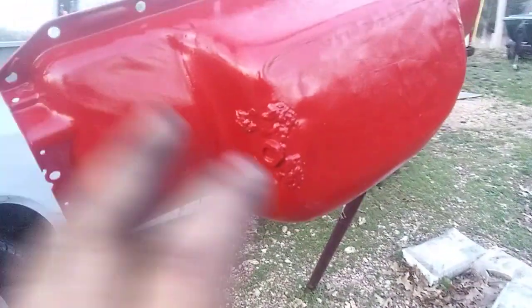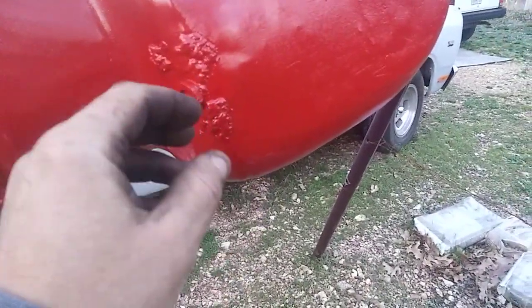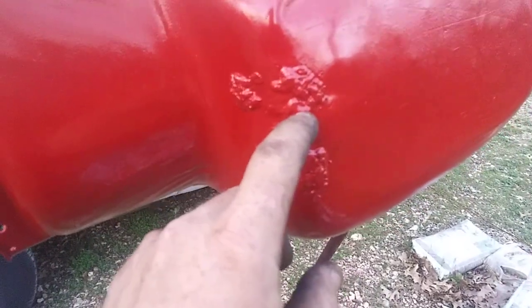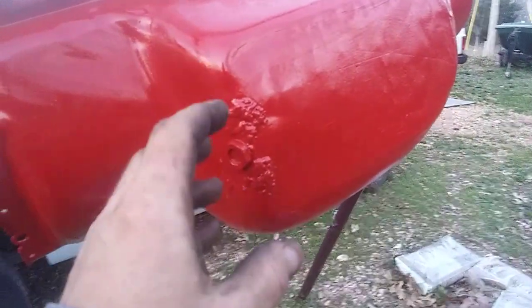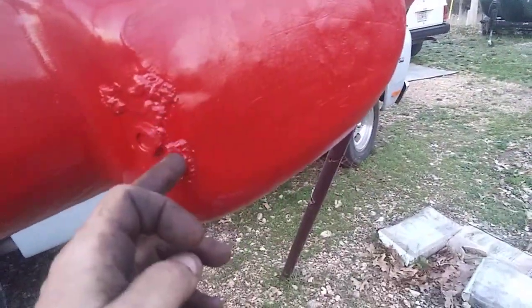I took it over to the sandblasting cabinet, flipped it upside down and sandblasted all around the big areas. Then I gave it several thick coats over that whole entire area. Prior to that, I retested it and it didn't have any leaks — it wasn't sweating any water. It looks like a bunch of bird crap or snot welds, but at least it won't leak anymore. They also had JB weld clobbered through there — whatever they hit cracked the pan, so I had to fix all that. Now it's got several thick coats of primer and several coats of red paint, and it's all nice to the touch.